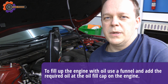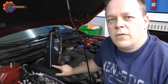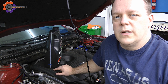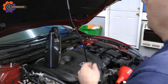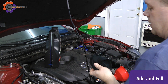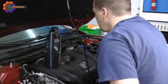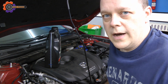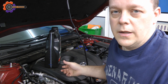Unfortunately my memory card ran out of space and I wasn't able to show you when I was filling up the engine with oil. However, I did make a mark on my oil jug for approximately how much oil I needed to add. Don't get too concerned about exactly where that mark is — what's going to dictate the amount you need will be from your dipstick. Your dipstick usually has an add and fill indicator, and in this case it has two dots — you want your oil level between these two dots. You just don't want to overfill or underfill, so I'm going to take my vehicle for a drive, bring it back, let it cool off for about 10 to 15 minutes, and then check the oil again.